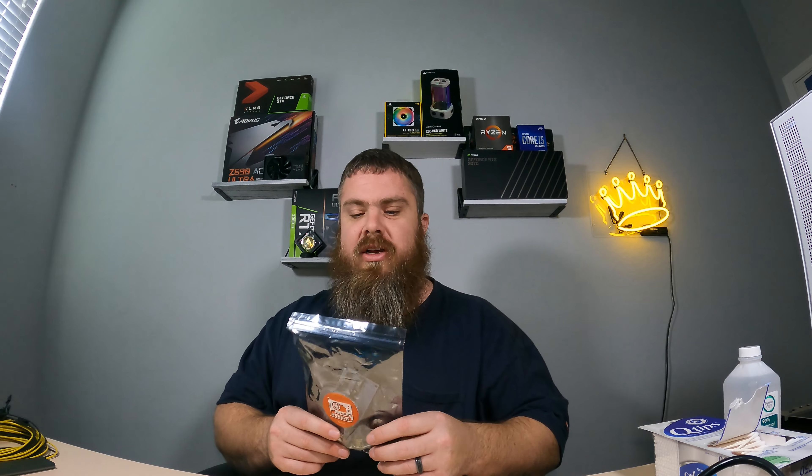The next thing is, if you're not using a riserless motherboard and you're using risers, I like to keep extra risers on hand. I bought an extra box from gpurisers.com. I've already replaced a couple, and I've only been mining for a year. The first two sets I bought from Amazon were blue ones — they're garbage and don't last. I've slowly been replacing them as they fail. I always keep an extra box of risers because you'll see GPU errors and sometimes a rig will come up with one card down and just not mine at all — that's usually a sign you need a new riser.